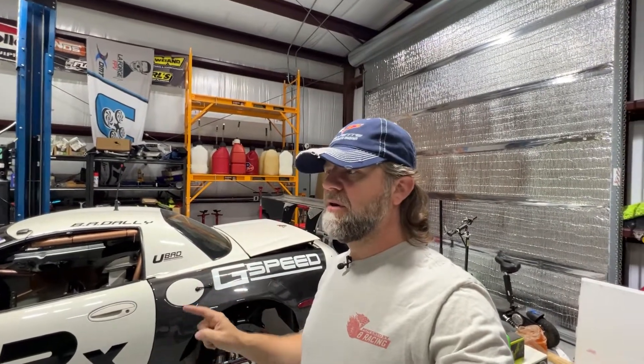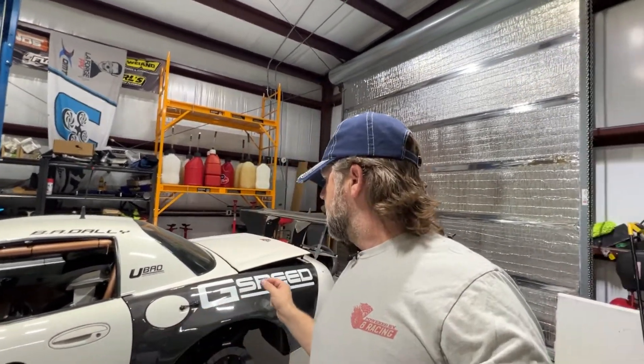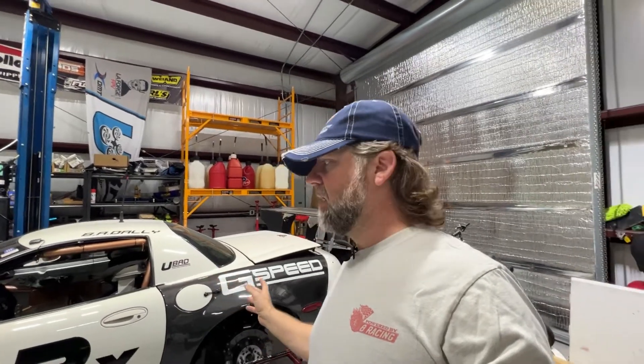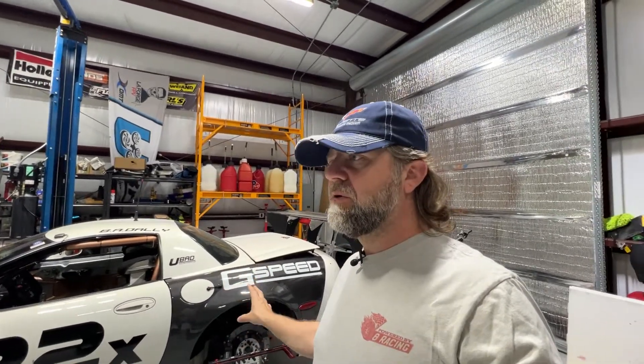The rear is going to be faster than the front because we don't have to worry about caster in the rear. The steel frame cars are going to be the same as what I have, and the upper control arm isn't adjusted with shims like we do with the front. The aluminum frame cars, like the Z06 and the ZR1 of the C6, have a different upper control arm — shimming might be an option for quick adjustments at the track. On this C5 with a steel frame, we're going to adjust our camber via the AMT plates.